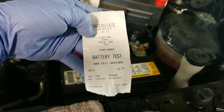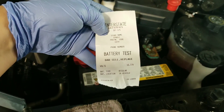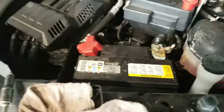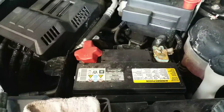But as you can see, and I will be running this on the GR8 to confirm, but with the handheld it says that your battery voltage is 10.77, which means that it has a bad cell and needs to be replaced. So what caused it I can't say, but you definitely need a new battery.